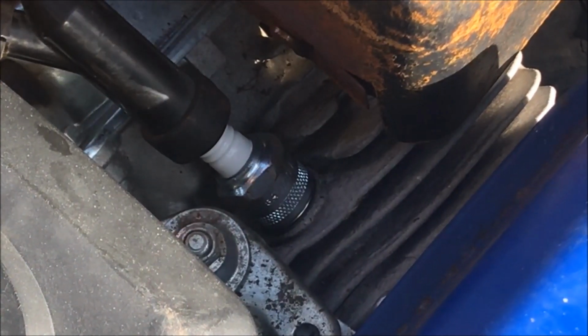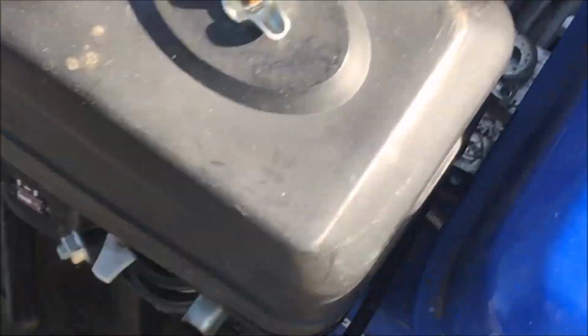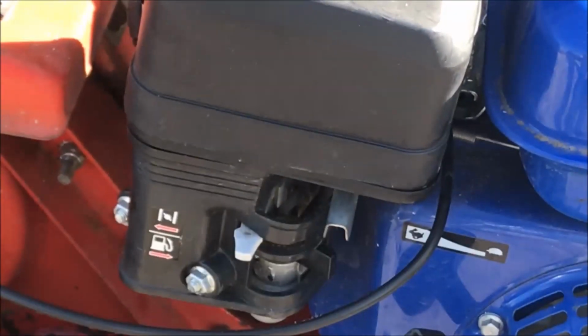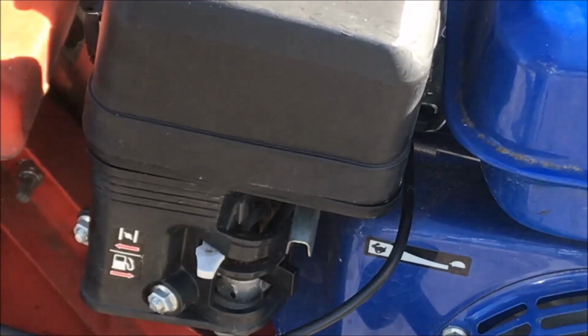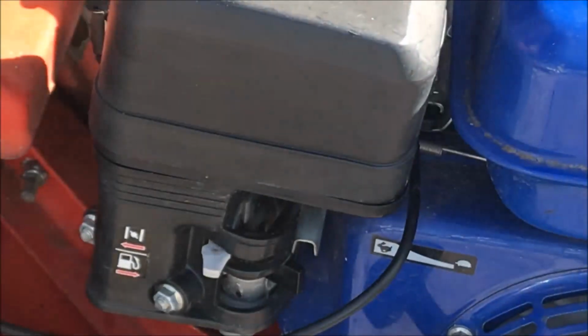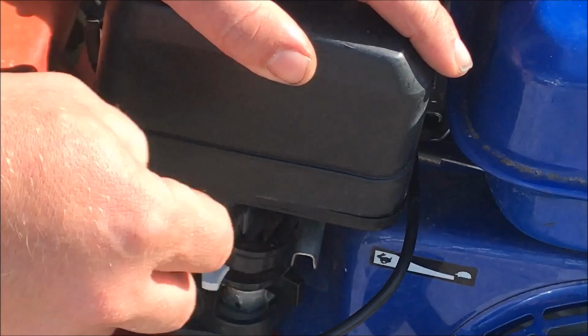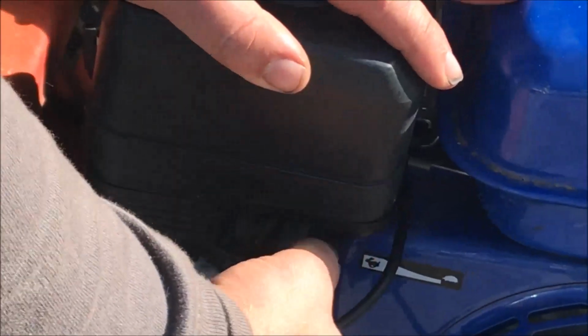Plug the spark plug wire back in there. Alright. And now we'll see if that new spark plug works, which, I mean, that old crapped out spark plug worked. I don't see why this one wouldn't. Now remember, always make sure that that little switch there is on. Very important. Make you look like an idiot. Choke, fuel, already checked the gas tank, full throttle.